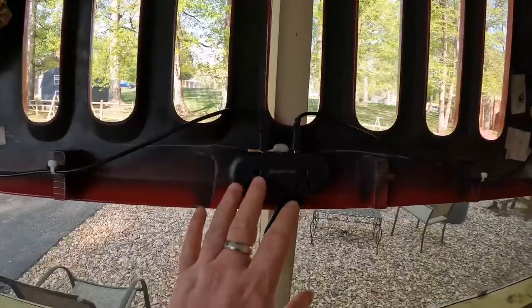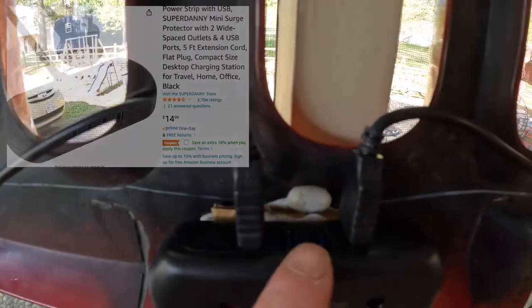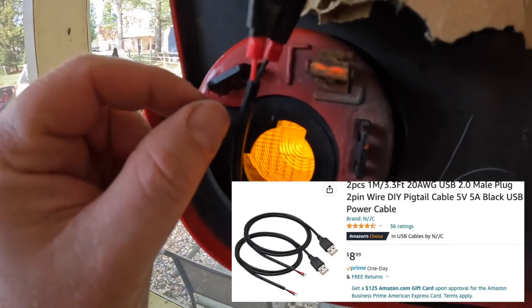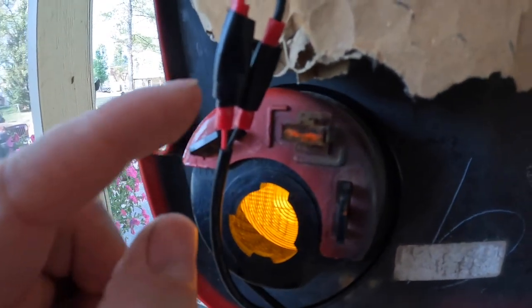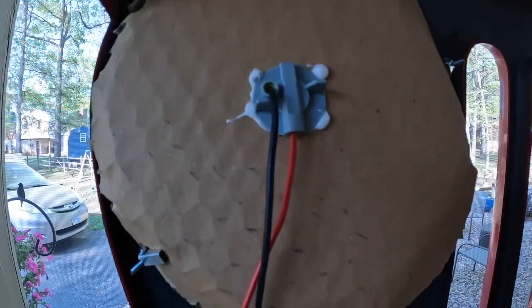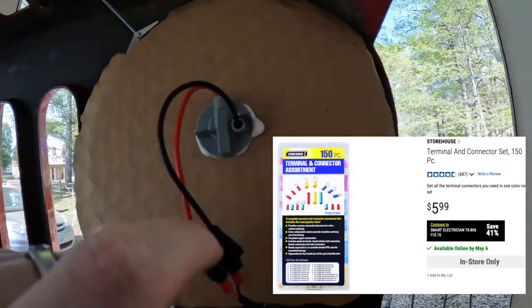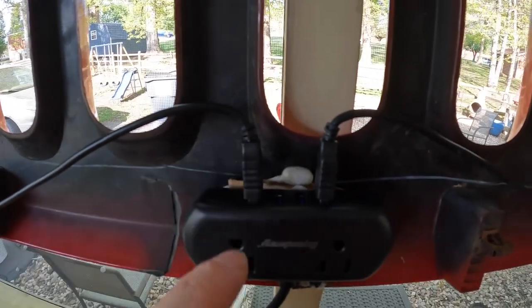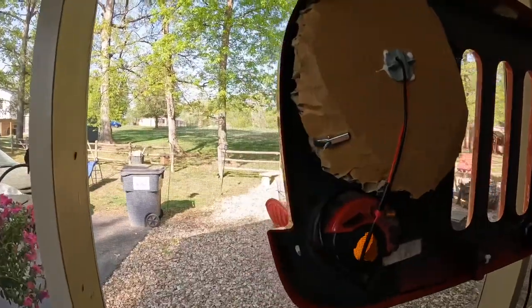I'll put links to everything down in the description — I bought a lot of it off Amazon. This is just a basic power strip that you plug into the wall, and I went with this one because it has USB ports. Coming out of the USB ports is some USB cable — it's just a stripped cable that breaks off into your red wire and your black wire. You're basically gonna use a coupler connection to connect it to your turn signal bulb socket. Very simple wiring: red to red, black to black. You just repeat the steps on the other side. I used Gorilla Glue to mount the turn signal bulb sockets.